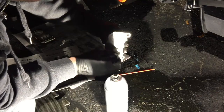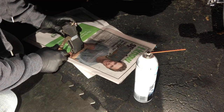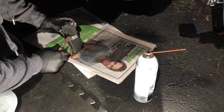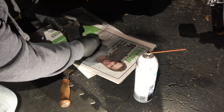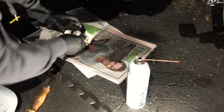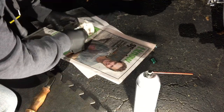One of the things I wanted to show you: when I removed the shim from the second pad, there was a label — a piece of paper — in between the shim and the pad, and not a lot of grease. Again, that creates a gap for that thin metal to vibrate, making that squeaking sound. So I'm assuming it's just that lack of grease that didn't stop the vibration causing the squeak. It wasn't something wrong with my brakes — I had plenty of pad left — it was just that air gap between the shim and the pad that caused this problem.